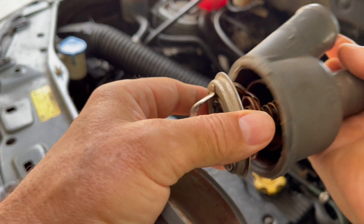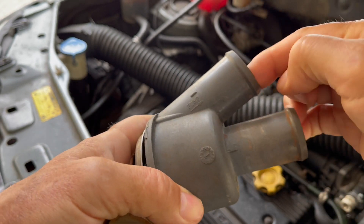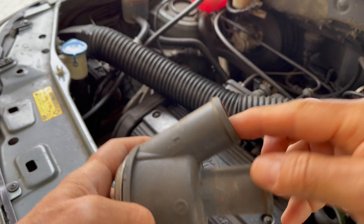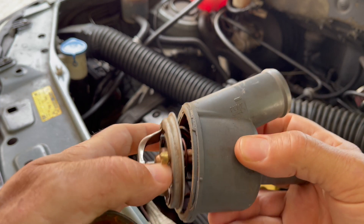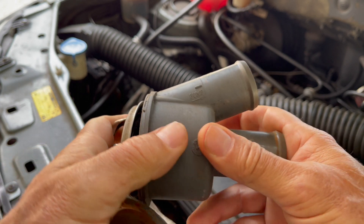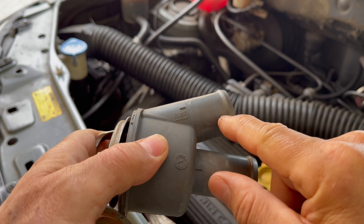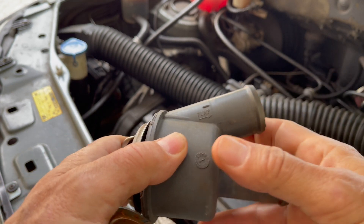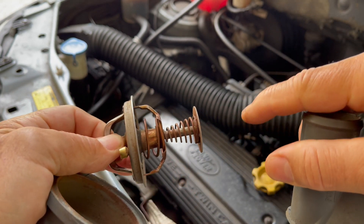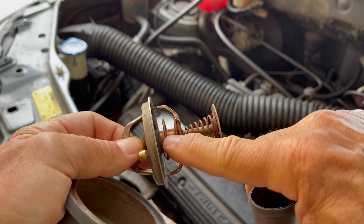If the thermostat is closed then the water can only go out of this hole, which is the bypass connection that goes off and just circulates around the engine. So it doesn't instantly cool the engine down — it just circulates it at a faster rate. You can see here it's marked 'to pump' — that's to the water pump by the inlet side of the engine. The other thing it does: when more hot water is circulating, if the water's hot enough it'll open the thermostat.